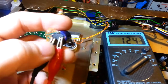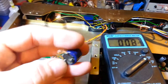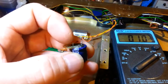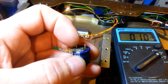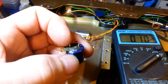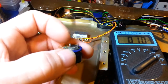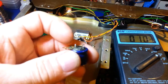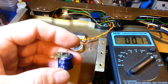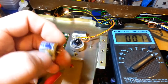I have no doubt about what's happened inside — I've torn a bunch of these apart over the years. When they're like that, the inside has actually corroded. The little strap of aluminum that's crimped onto the two aluminum plates and attached to the copper lead just oxidizes off. The aluminum oxidizes and basically corrodes away, so that capacitor probably hasn't been doing anything for quite some time.